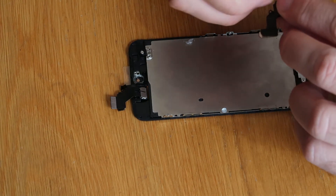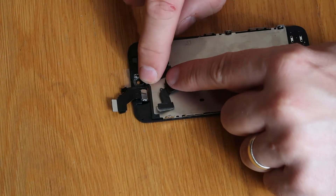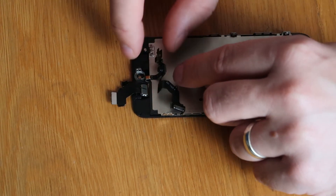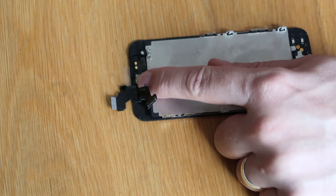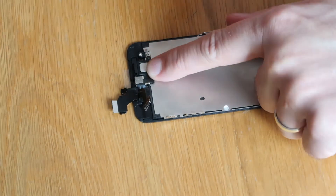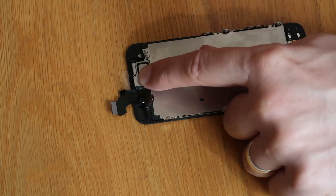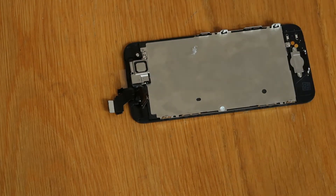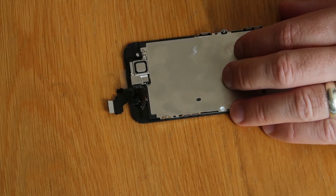So we've got our little mic jack here — we're going to push this into the little rubber grommet, and then fold the camera assembly over on itself so everything fits down really nicely and snugly into place. And then our speaker pushes down and we get our speaker bracket. That will hold absolutely everything in the right place. Grab the two screws — the shorter screw goes on the right-hand side, and the longer screw goes at the top, and that will hold everything in place.